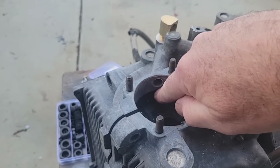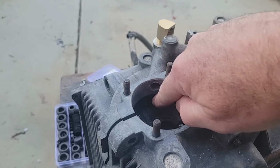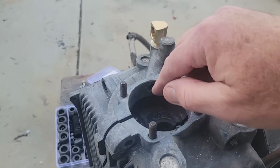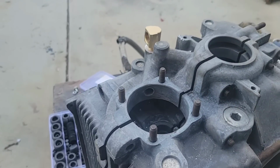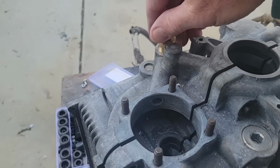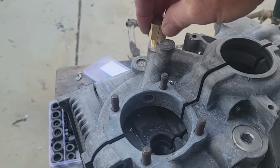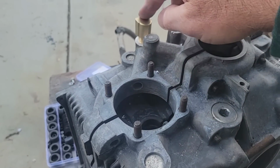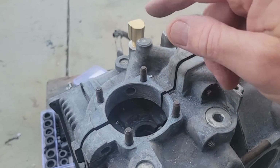But on some of the aluminum cases, a lot of times they're kind of not too loose, but a tiny bit loose, and people say that you can get a low pressure idle. I don't think we've had that problem from just doing the mag cases, but on the aluminum cases, I'll do both. So just so you know, that's the way I do it. Almost any of the stock aluminum cases are not drilled, I don't think, okay, for full flow. But if you get a bubble top, it's going to be drilled for this already, and I'll plug those ones. I'll plug the back side of them, plug both sides. I'll plug the pump and the other.